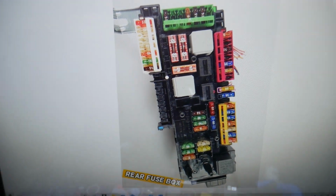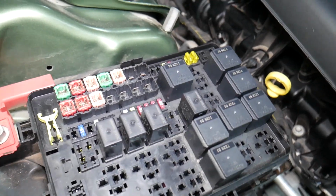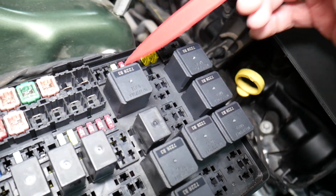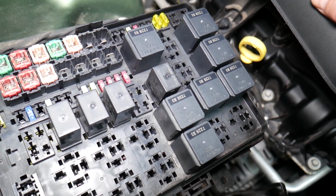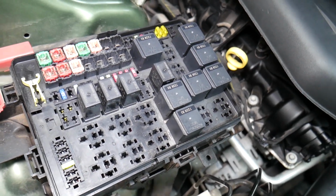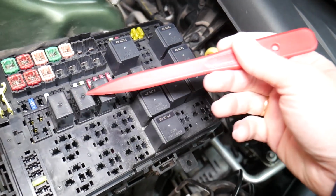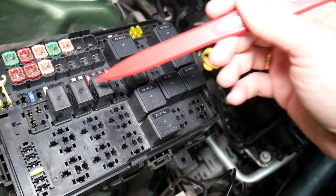Now, before we continue, let's explain quickly why it's always a good idea to test fuses and relays. It is super important to always test fuses and relays, and something else as well, common mistakes people make. Sometimes you may think that a fuse is good, or you cannot actually see if the fuse is clearly burned, and in that case you may put the fuse back and you may end up spending money and time on parts you don't need, and all we had to do is just test the fuse. So we'll put a link in the description of the video below how to test the fuse. It takes only a few seconds to find out for sure if it's good or bad. The same thing for relays. Some of those could be really expensive on cars, so we'll put a link in the description of the video below how you can test relays.